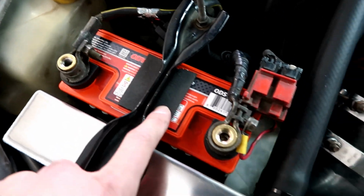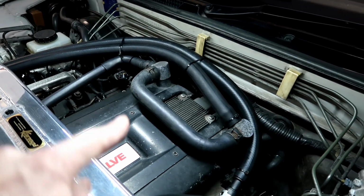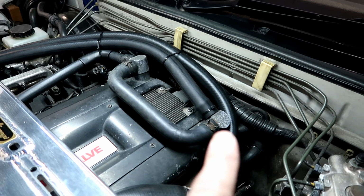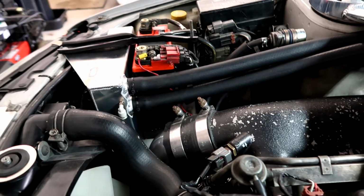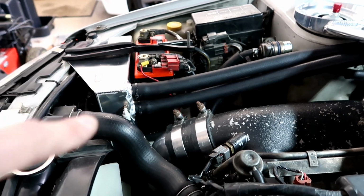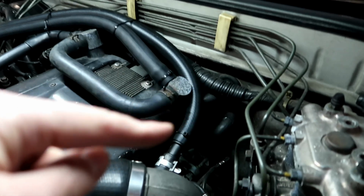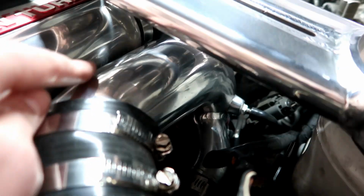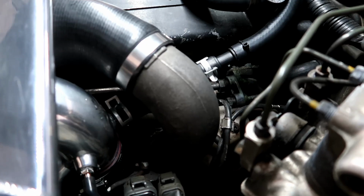And yeah, this is awesome. The PCV valve is connected, and it comes into the left side of the breather, and then you've got the crossover, and then it comes out of the right side of the breather and travels down over here into the bottom of the catch can. The air swirls into the bottom of the catch can, and the air gets separated from the oil. The air continues to travel out because there's a baffle in here. It comes out of the top, travels up through the tube here, and then back around where it has vacuum to this, which is connected to the hard pipe right down in here. That is in front of the rear turbo, which provides vacuum, which aids in extracting all of the gases.